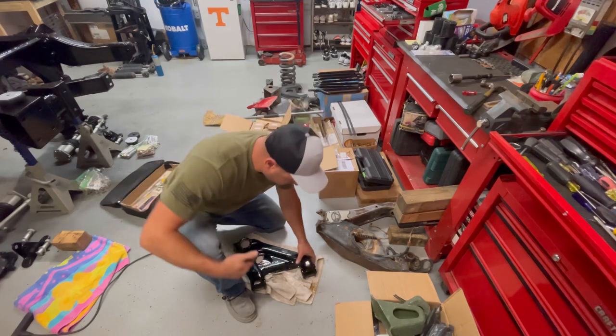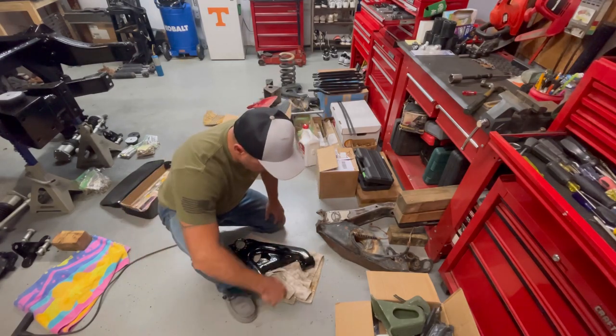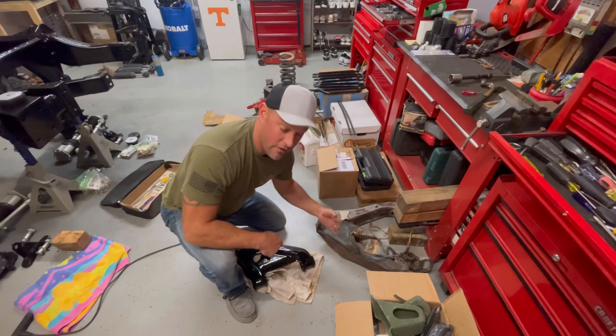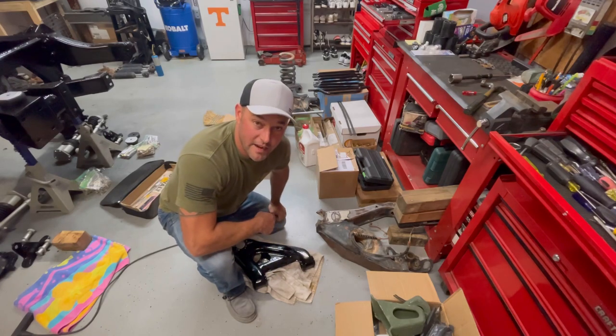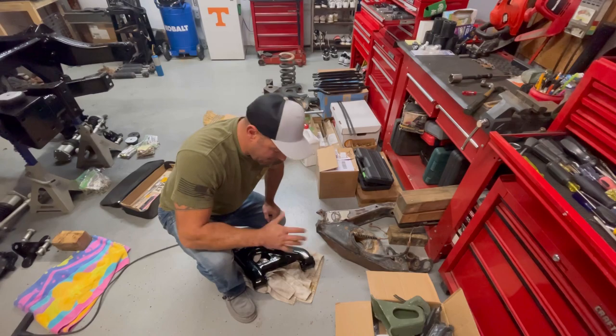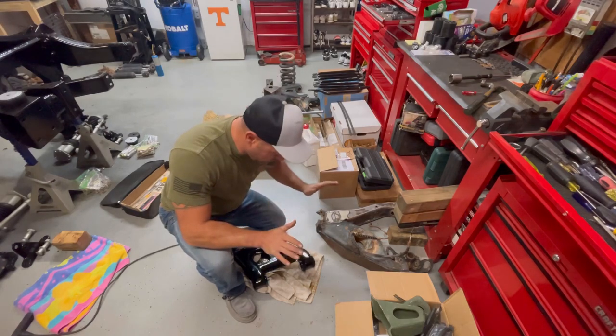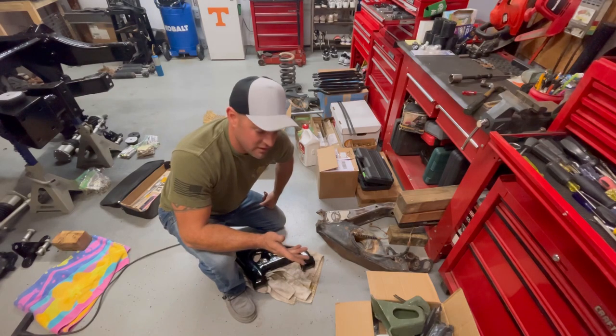So what I did, you saw I made a slit all the way down just with the Sawzall and then just take a flathead screwdriver and where it broke at, just give it a whack, just one hard tap and it's going to fold in a little bit and you can just tap it out. I thought I was screwed when this started to happen. I'm like, oh my gosh, how am I gonna get all these out? And now I got 16 to do.